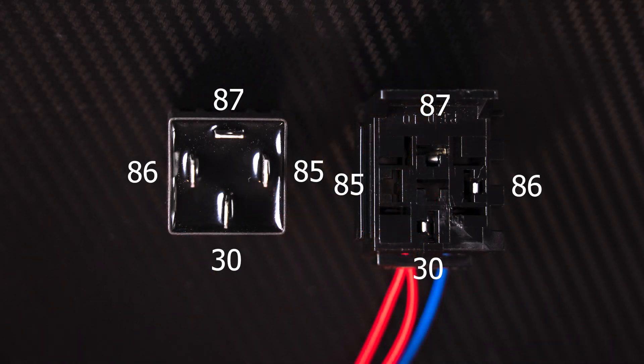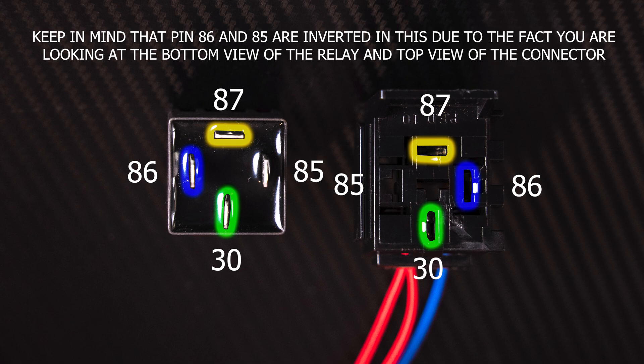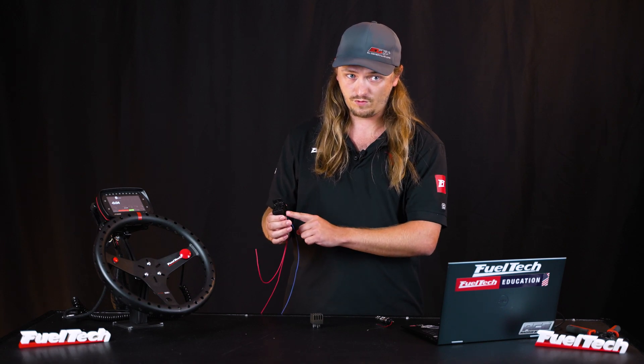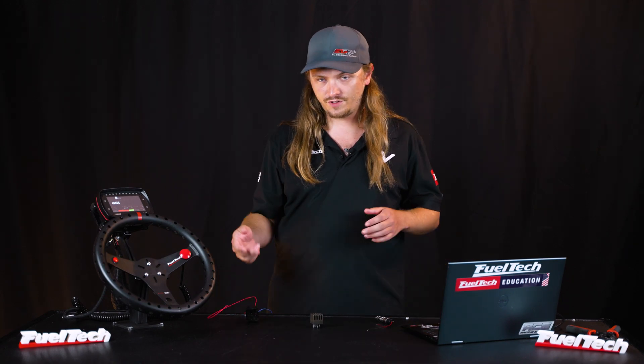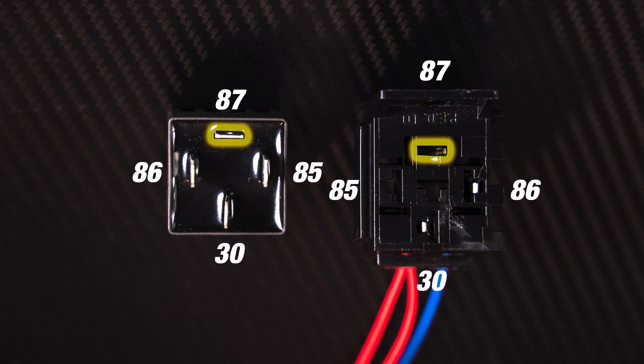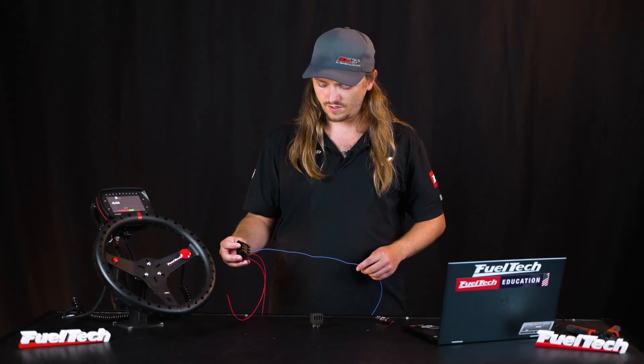Here's the quick and easy breakdown — this is what you guys probably came here for. These are the three pins we use on this relay. The side we do not use: if you have a wire over there, get a small tool and delete that — it's not going to work if you ground-activate or 12-volt-activate that pin. This relay has to have ground on the correct pin to work, period. The front pin of the relay is just switch power. This other side is ground-activated by the ECU.